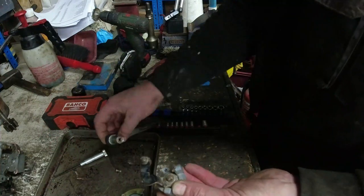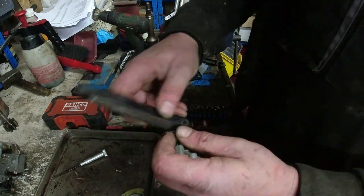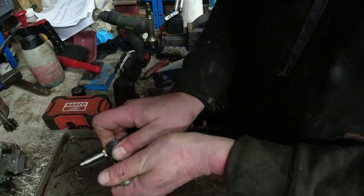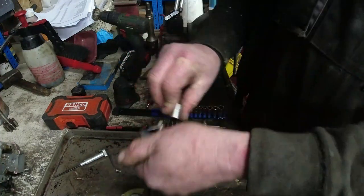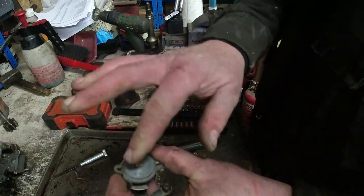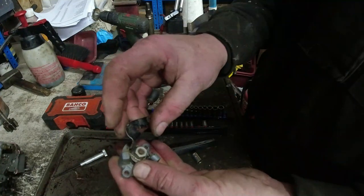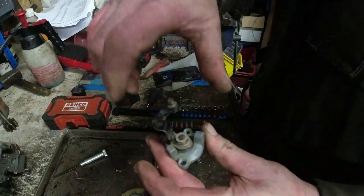We'll put the nut back on — which is still inside the wrench — then I can pop these two back onto the carburetors. Now we've got two chokes working. The things I look for: that it's the right way round, make sure the disc pushes up neatly inside, make sure the disc is smooth — I've seen one with a big dimple on it, machining fault. Holes are clear, and the spring works.